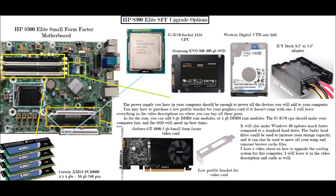That adapter will go into a 3.5-inch bay — the same bay your old hard drive was in. So you will take that hard drive out and replace it with the SSD and the 2 terabyte 2.5-inch hard drive, giving you more and faster storage capacity. You would install the operating system on the Samsung 860 EVO 500 gigabyte SSD and use the Western Digital 2 terabyte SATA 2.5-inch hard drive as a secondary drive.